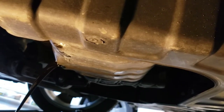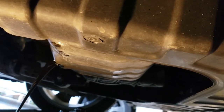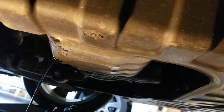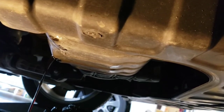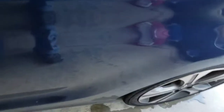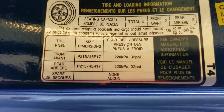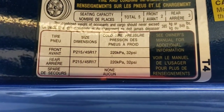After that I like to check the air pressure in the tires and all your fluid levels under the hood — your radiator, windshield washer fluid, brake fluid, everything under there. Just do an overall check on everything. You can check your air pressure while the oil is draining out. It's listed in your driver's side door panel — 32 PSI for the front and 32 for the rear.